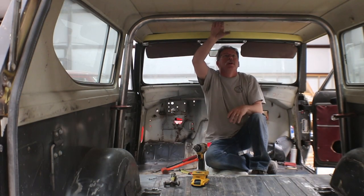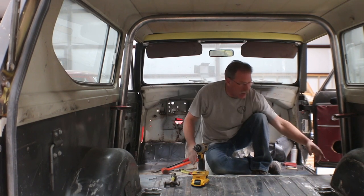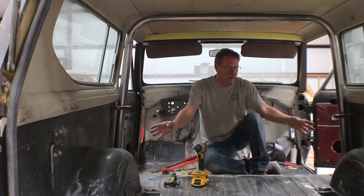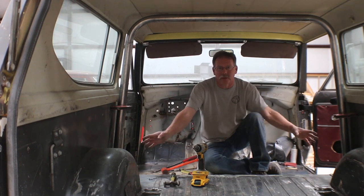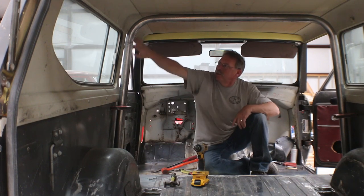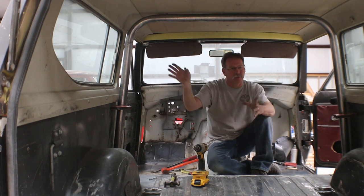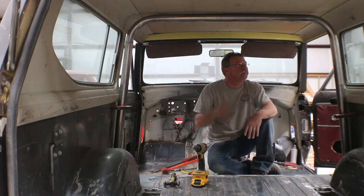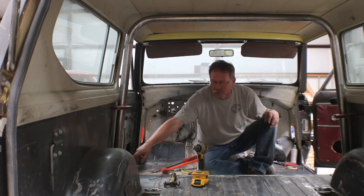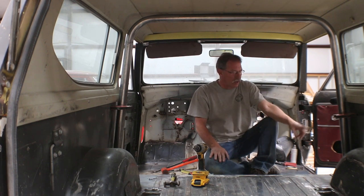We've got the roll bar sitting in here with magnets on each side. I've set the base by measuring from the edge of the door jamb on both sides to make sure the bottom of the roll bar is the same distance back on both sides. I'm going to weld this side first, then lined it up with the B pillar in the roof so that whenever the roof is on they're in line. I couldn't get it directly behind it because it wouldn't fit with the seat, but I at least want the line to be the same. I've got a little spacer to keep it off the body.